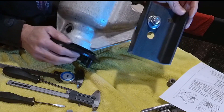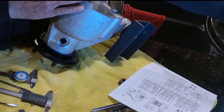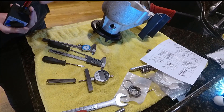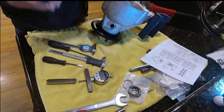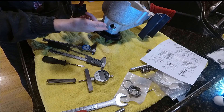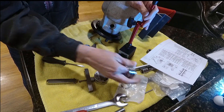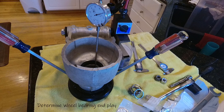You probably also noticed that magically this piece of steel ended up here — that is for this. This is another tool that we're going to need. The dial indicator is to measure the distance between the back of the bearing and the back of the hub so we can determine which size shim is required in order to maintain the proper preload. We're going to use shims — rings — I don't know what they are. Let's get on with the measuring to determine what size spacer we're going to need.